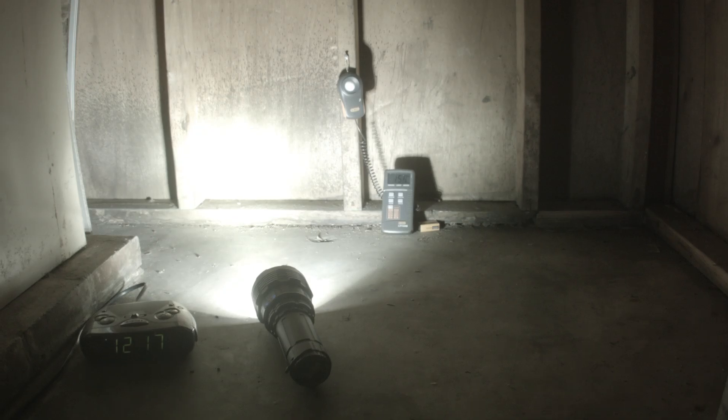And finally, the 1,500 lumen mode — which according to me actually runs brighter at 2,700 lumens. Over the first 10 minutes we lose less than 1% brightness, still over 2,700 lumens. At the 1-hour mark we've lost 3%, so about 2,600 lumens. At 2 hours we're still the same. At 3 hours we're still above 2,600 lumens. It finally shuts off at 5 hours and 20 minutes at 2,600 lumens. Imolent claims 7 hours, so I told you so.